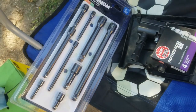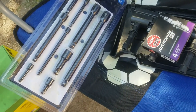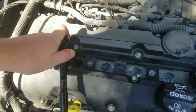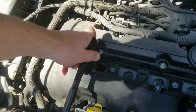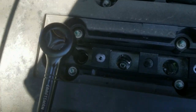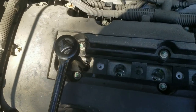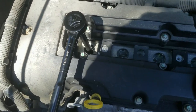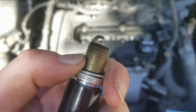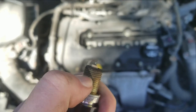I got the extensions — I got the impact ones because they're on sale, not much more than the regular. Now I have the right length for spark plugs. That's a much better fit; I can actually get in there and take them out. One thing to note: you don't want to leave the hole open too long — you don't want debris in there because that's your cylinder. Have the new spark plugs ready. There's the old spark plug — it's not horrible but not great either.